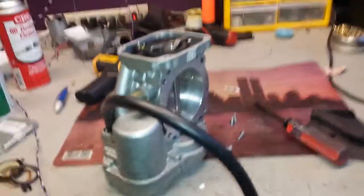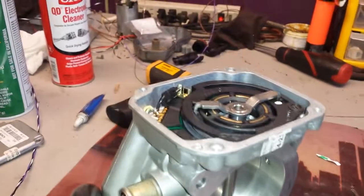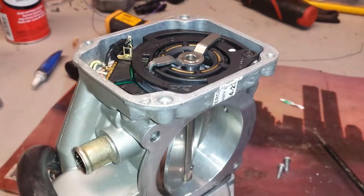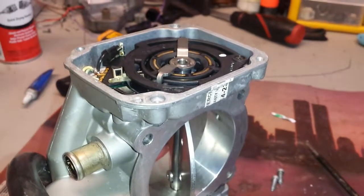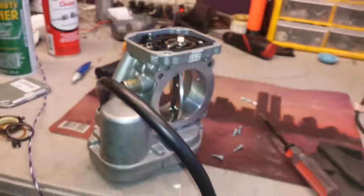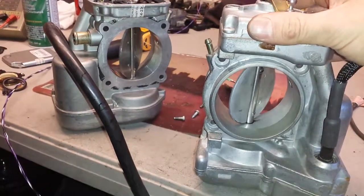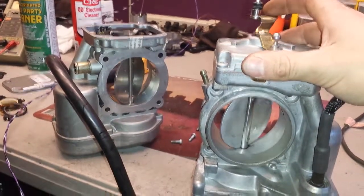That's the twitching, and here you can see it — it opens and closes. Looks fine. This is a '93 eGas module, so the throttles don't open all the way when the car isn't running, so the opening is limited. But you can see one unit controls another.